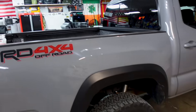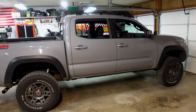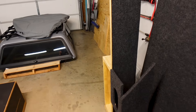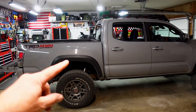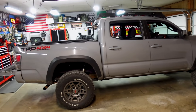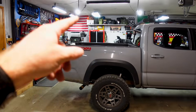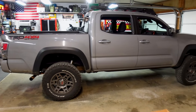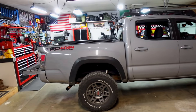Something else I didn't mention — I just installed this lift kit on my truck and it's supposed to have leveled it out. As you can see now, the truck is completely level. But running that with all of this back there, I got worried after I installed it and went and measured it. The back of my truck was actually about three-quarters of an inch lower than the front. I checked all my measurements and my blocks, but then realized it was all this weight back here actually weighing it down. So now that it's all off, the truck is completely leveled out — it's perfectly level now. It was just the weight of all of this in the back.